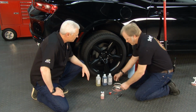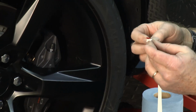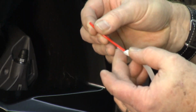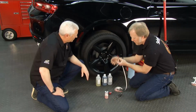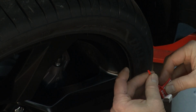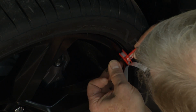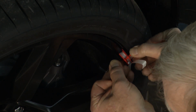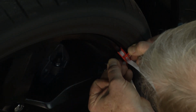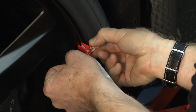All right. So I've already taken one of the stripes, cut it apart from the rest of the roll. You expose a little bit of the adhesive side of the tape, contact it to this piece we call the Easy Feeder. That lets you pull the tape up and through the little guide channel. And we've already set up the tool to reference the outside edge of the rim, so I'm going to hold the tool nice and steady while you rotate the wheel steady and not too fast. And the tool does all the work. You can see it's keeping it nice and parallel to the edge.